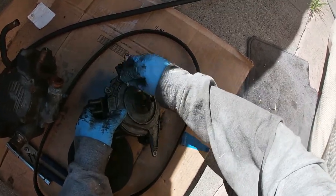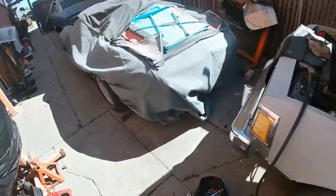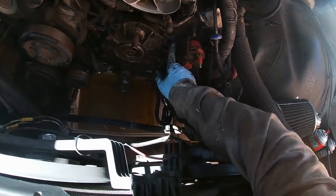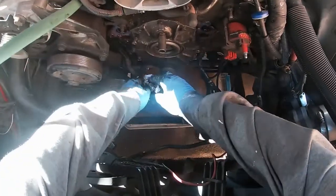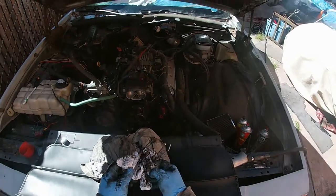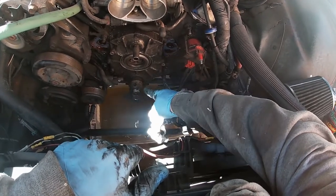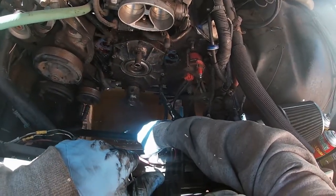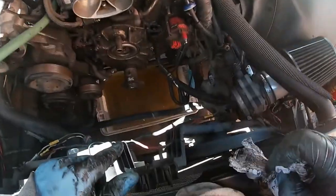For the price of the kit — which is like $10-$15 — I'm gonna get a FelPro one. It comes with both O-rings, it comes with the water pump gaskets, the timing cover gasket, and this seal right here and this one. I think that's it. Oh, it comes with the bottom one too but I don't think anyone's changing that one. There was one of these at pick-and-pull I wanted to get, but now I'm kind of glad I didn't. This right here you just pry out with a screwdriver, and this one you just pry out with some channel locks.